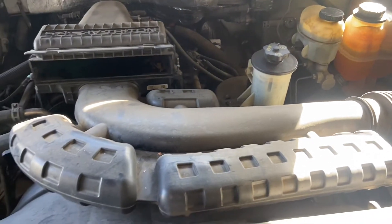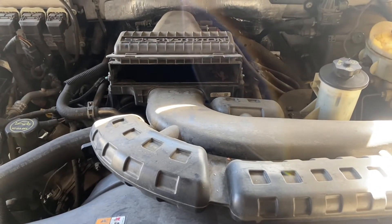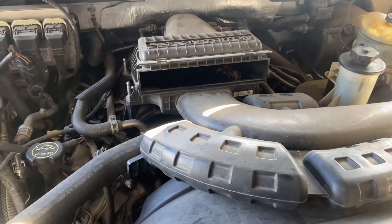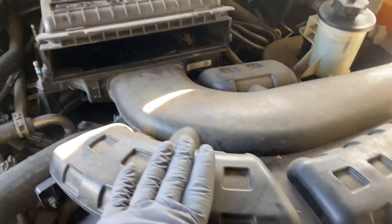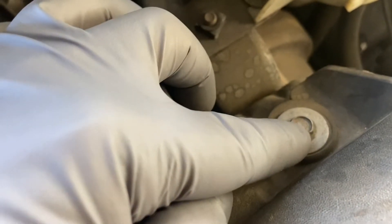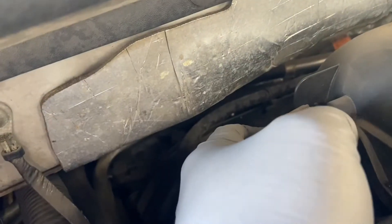Good morning. We're working on a 2006 Ford F-150. It had several throttle actuator control codes: P0121, P2111, and P2112, all relating to the throttle actuator motor and the throttle position sensor. We tested all the wiring and found out we didn't have the proper output from the TPS. So instead of changing the throttle position sensor, we're changing the entire actuator assembly.